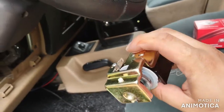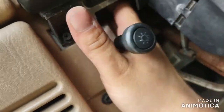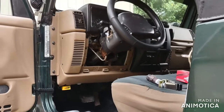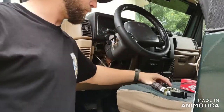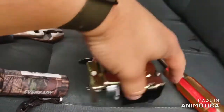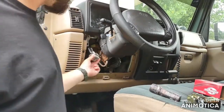On the old one, you're going to press that button, which will be on the top right back here. You reach up here and there's a button — push it down and there comes your pull knob. See that little black plastic piece? Use some pliers to unscrew that, because it will screw in to the front. When you unscrew that black plastic piece, your switch will fall out.